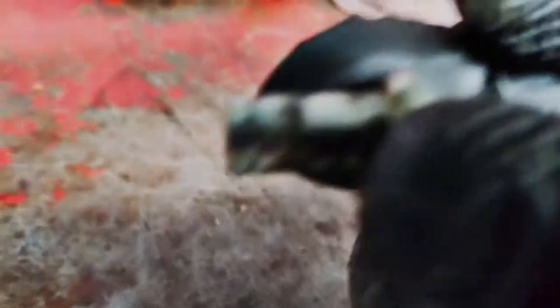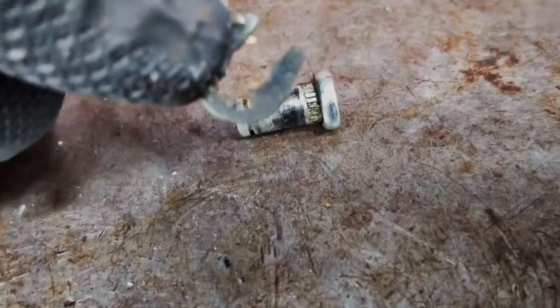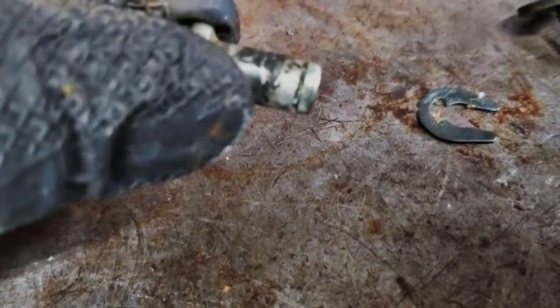Now that we're out here we can see a little better. This is what this pin looks like — it's going to sit in there, and this little clip right here is going to be what's around this. What I do is use a 90-degree angle pick to catch the open part at the end here, and you should be able to pry that right off. Then you're just going to pry the pin out of that pedal assembly.